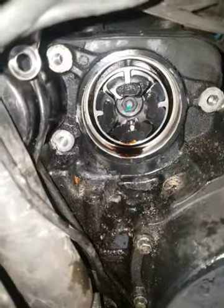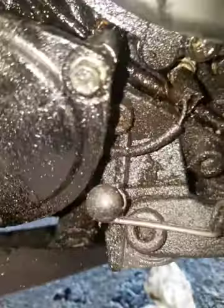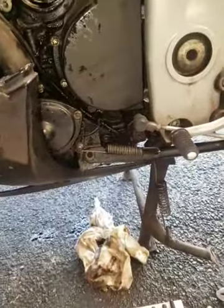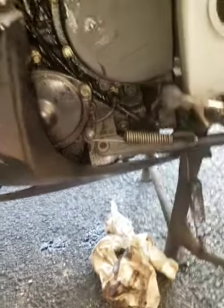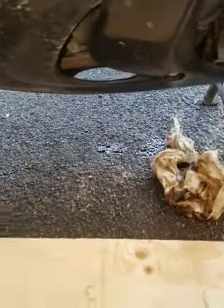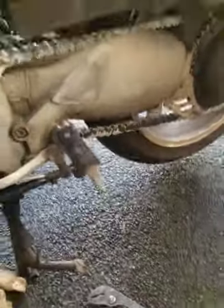What happens is annoying. The oil leaks down and ends up on your exhaust pipe, which gets hot and stinks of smoking oil. Although it does protect the undercarriage from rust, it also puts oil on your drive and, potentially dangerous, it could go on the back tyre.